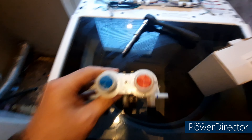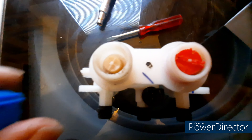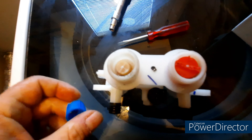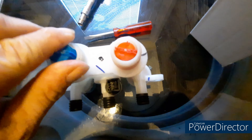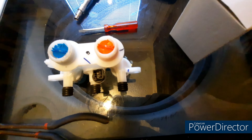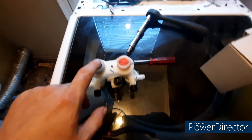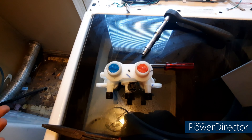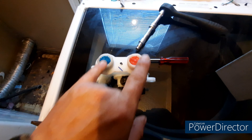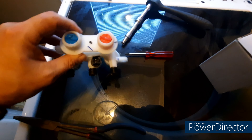That's where the filters are. You'll want to make sure these aren't clogged with grit and dirt. That's what it looks like inside. I did mess mine up trying to pull it out — they were wedged in there and I couldn't grab with pliers. It's more common — it tends to be an issue with people who are on well water, which is what we are. Even with filters, over time deposits will build up and eventually affect the sensor.